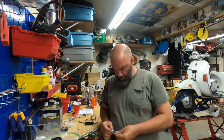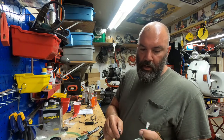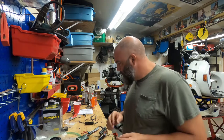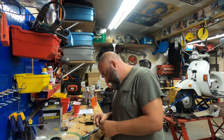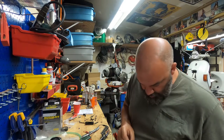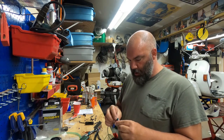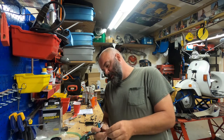Check a few things out real quick. All right, should be this. Yep. And what's this guy? Nope, nope. Okay, good. Anything else green? What's green and white? Nothing there. Okay, that's definitely the kill wire. Let's just make sure that corresponds with this. It does. It does not correspond. Does not. Which I think this is the brake light switch, rear brake switch. Let's see. Yep. Okay, so that's power for the brake light switch, which means this also powers a secondary something or other.